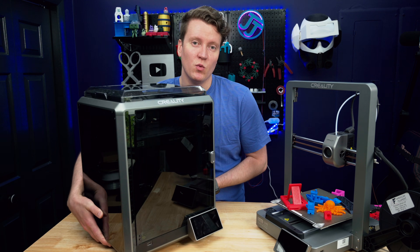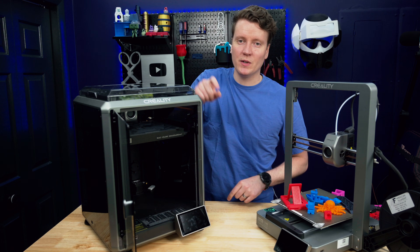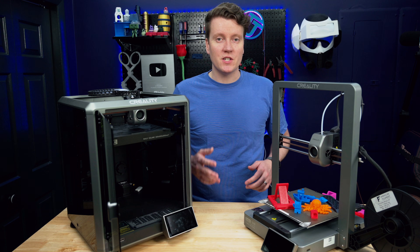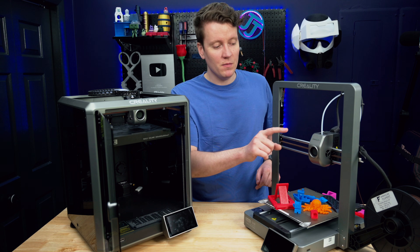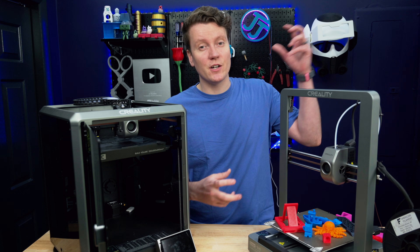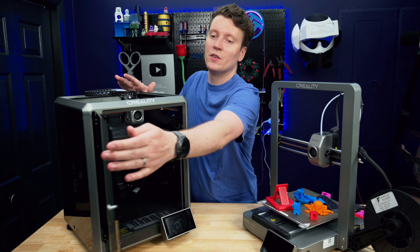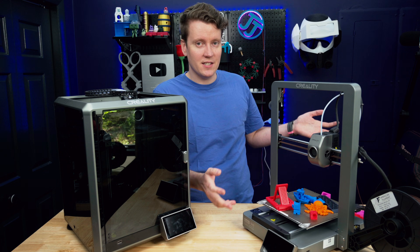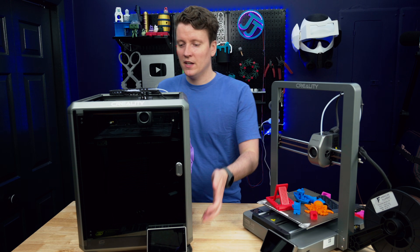I also think we should compare it to the K1C. This is a very similar printer, and once you get them next to each other you really start to notice the similarities — it's the same color, matching the K1s rather than other Ender 3s. It really starts to show that this is just a vertical version of the K1C. The extruder is the same. The hot end and nozzle are the same — it's the new tri-metal unicorn nozzle, a hardened steel tip so it's going to last a long time, and with an integrated heat break you're less likely to get clogs. The big benefit of the K1C is that it's enclosed — you can fully enclose it and print high temperature filaments like ABS super easily. The V3 you could print ABS, but you'd need to put it in some sort of enclosure. The V3 is a small compact size, really easy to put on a table.